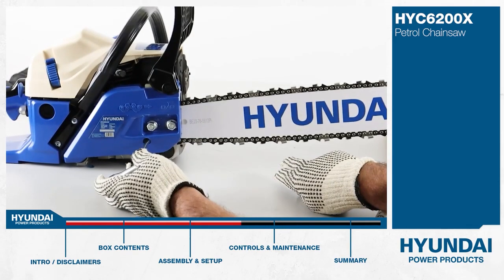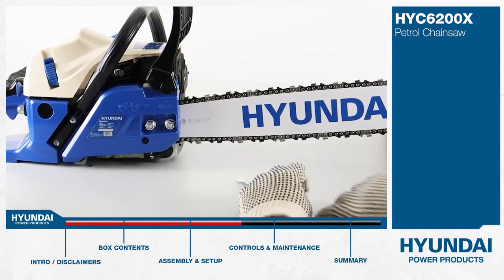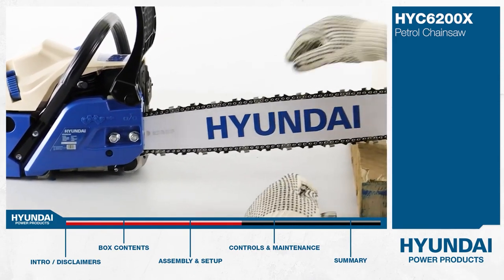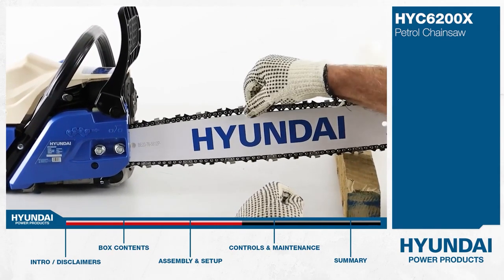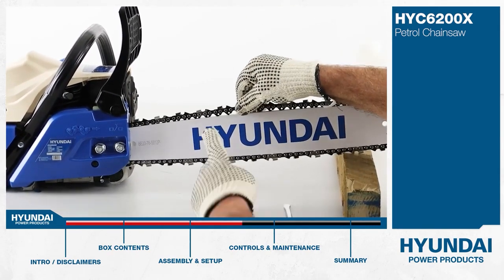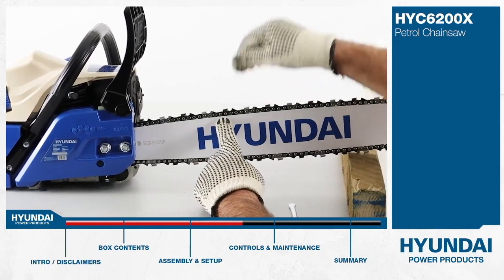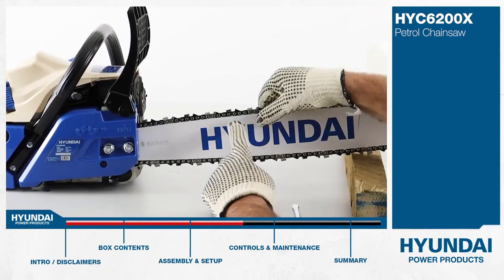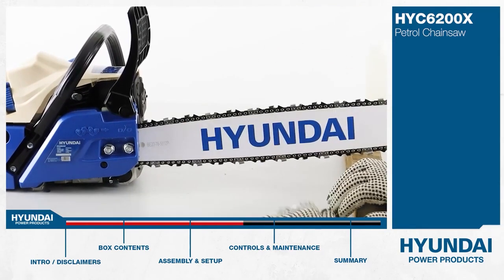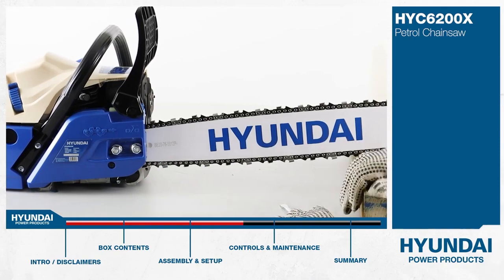So I'm just going to, as a starting point, just turn it so the chain's in the groove there. And I'll just have a look at the tension. Now, just with a finger pinch, I can lift that chain out of the groove to the point where it just about comes out. In fact, it does here. That's a good starting point, and it snaps back into the groove. So that's a great first adjustment.